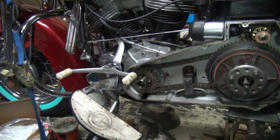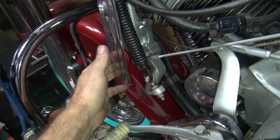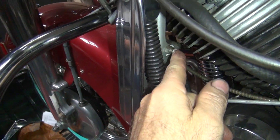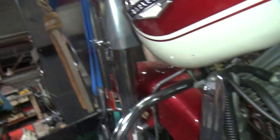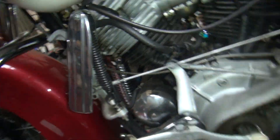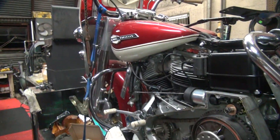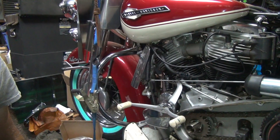Back in New York. We're back on that — it got interrupted. So we're going to dive into this problem here and see what's going on. This is supposed to go over center and stay tight. This screw is adjusted too far in if it's not going over center, and our cable needs to be adjusted to get some clearance. So I'm going to start over by readjusting this thing — we're going to attempt to see if we can make it work.